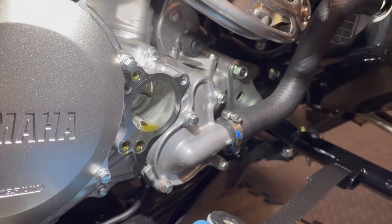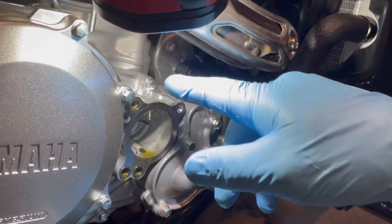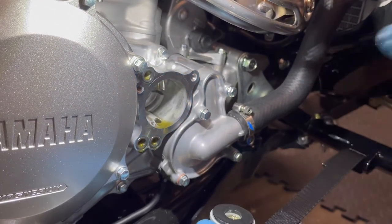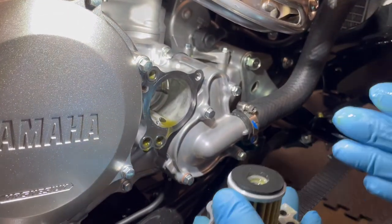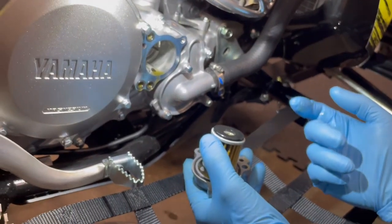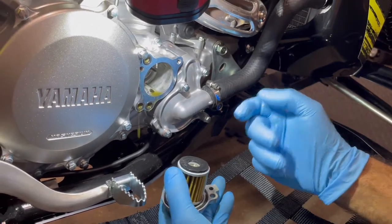but it literally splits, going around the case. But also straight ahead is the oil squirter, the engine oil squirter. And I've seen liquid rubber travel through this passage and go literally like a T and start to go on that loop for the engine case, and that starves oil to the transmission and the head, and then also starves oil at the bottom of the cylinder.